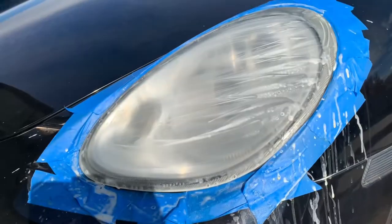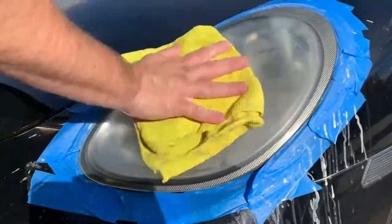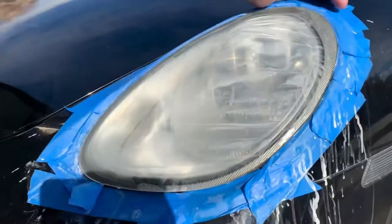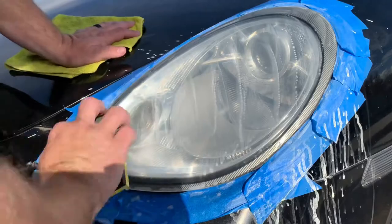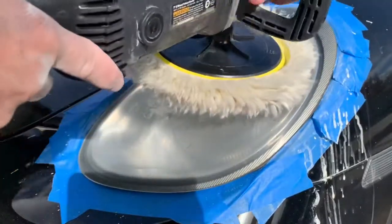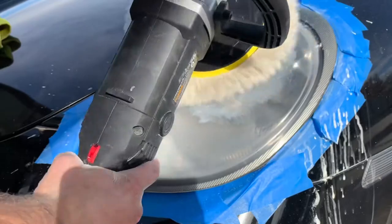Go through, make sure the headlight is extremely smooth, and after you wipe it down, make sure it is smooth and looks the same throughout the headlight. Then we go to 1,500-grit sandpaper, and then 2,500-grit sandpaper. Once that's finished, we will bust out the rotary polisher with some heavy compound. Work that in, make it shine.